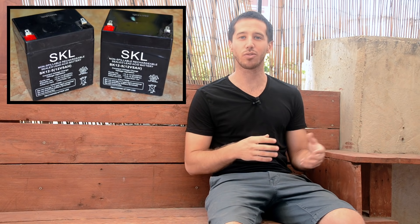This is really an artifact left over from the days of lead acid batteries, when lead acids were used for all ebikes. Lead acid battery cells are rated at about 2 volts, so it was very easy to put them together in groups of 6, and then you've got 12 volt batteries. From there, you can just make increments — 24, 36, 48 volts, etc. And that's how those voltages came to be common in the ebike world.